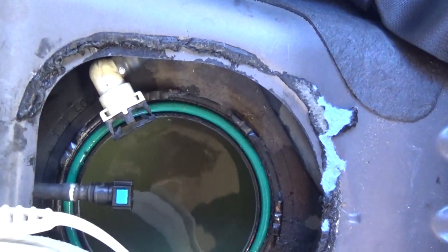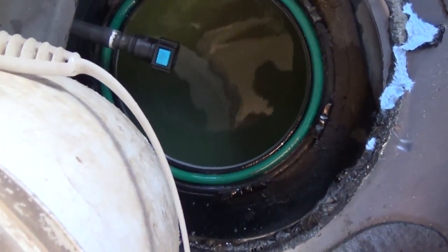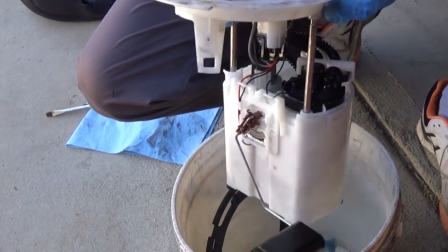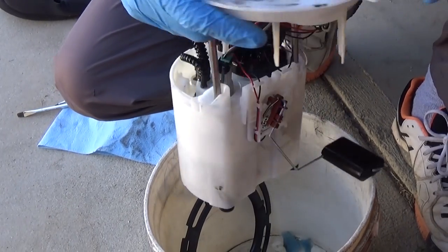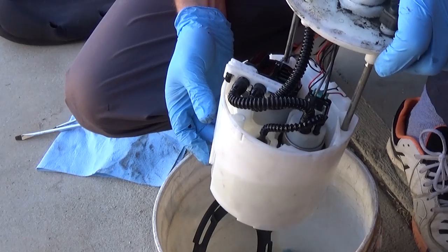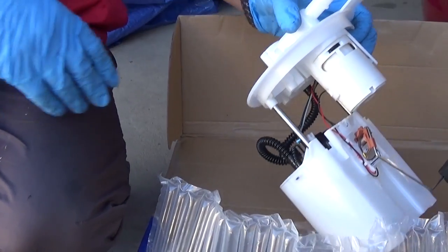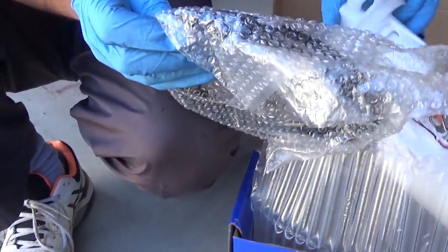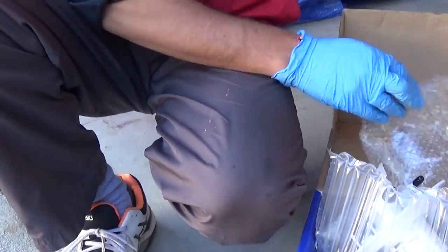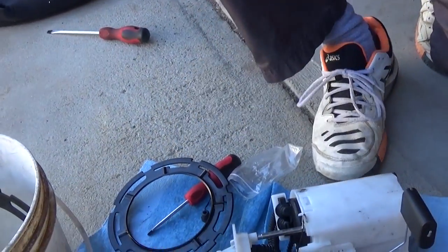You can see it's almost a full tank of gas. This is the fuel pump assembly — it's recommended to replace the whole assembly, not just the pump itself. We have a new pump; we'll have links in the description where we got the parts. It's a very affordable price and comes with a new locking ring, which you're supposed to replace every time.